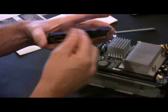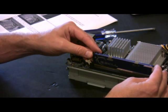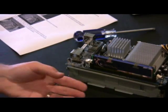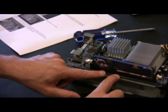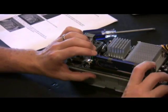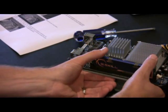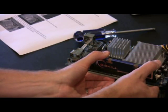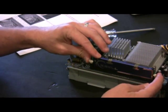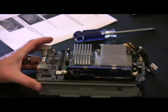I've got that backwards. So you always need to, before you start shoving RAM in, make sure that you've got it correctly oriented. There is a tab right here that does it. I'm looking to see how springy this motherboard is, because when you install RAM you don't want to bend the motherboard. It looks pretty taut, so I'm going to grab the bottom lip here and give it two big pushes. Right there — it's clicked nicely into place. We can see the little hold-back tabs have clicked nicely as well. Now we've got our RAM in.